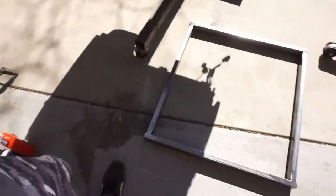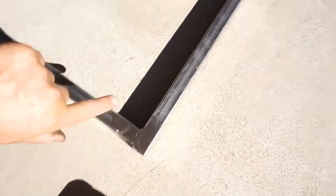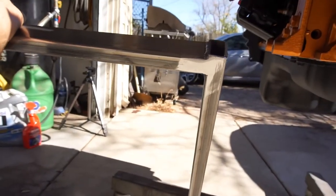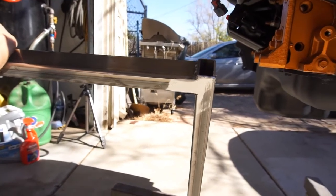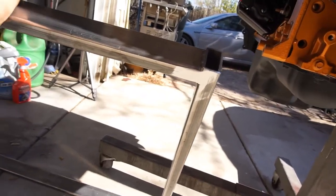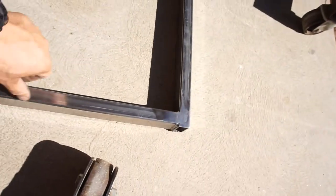As you can see, I already welded this box — it's 30 inch by 30 inch. I welded it and made it flat because I'll be putting wheels on the corners and probably welding them, so I want a flat surface. I ground it on both sides because, you know me, I get into a rush and I'll forget that one side's flat and one side's not. So I just get rid of all the guesswork and flattened it all. Welded it all the way around — top, this side, inside. That was hot, by the way.